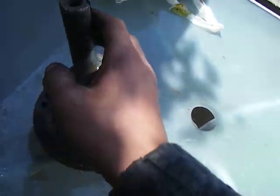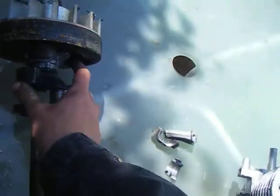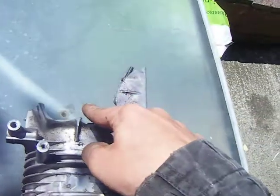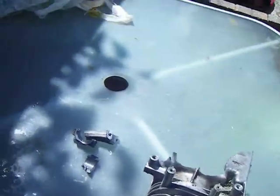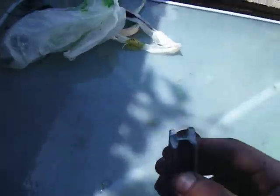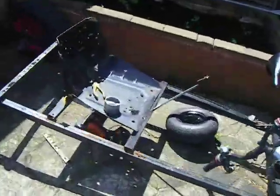Landed straight here. It pushed the whole crank down, up to the top of the engine, and this here, that's the top bearing, which should be here, and it's not there no more because the whole top bearing pushed out, and at the same time, snapped the rod off of the piston, which is over here, for some reason. It is. Here's the rod.